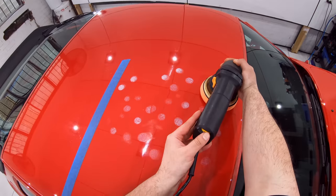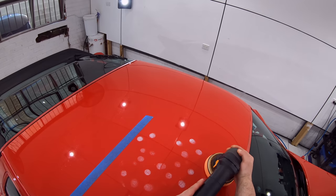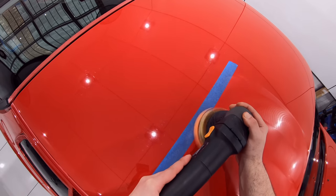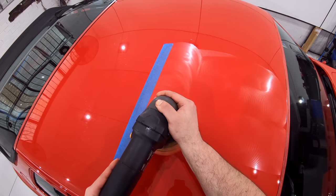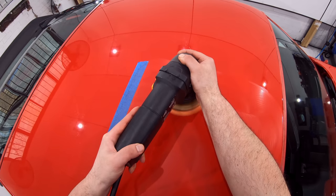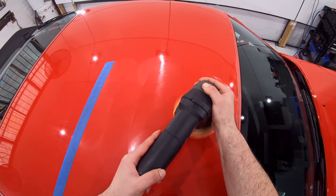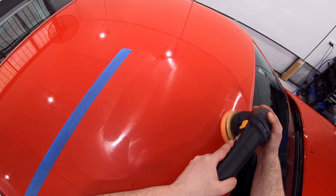So what this tends to mean from a paint correction perspective is that you're able to transfer the cutting power of your machine much better to remove existing defects on more rigid metal panels, and you're also able to generally finish better with the reduced heat and better heat distribution, as increased heat is one main factor that contributes to haze and marring in the finish, making it quite difficult to polish paint with good gloss and clarity levels.